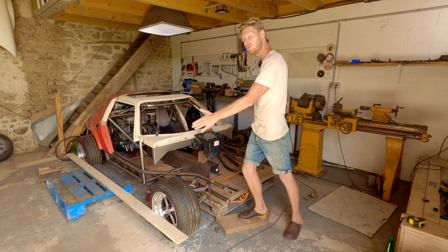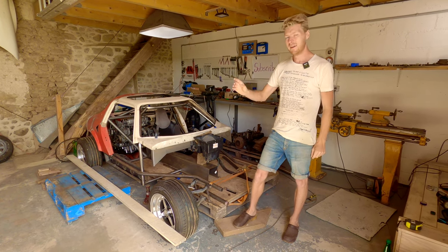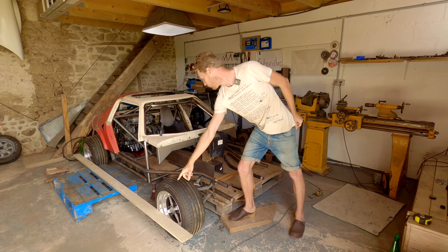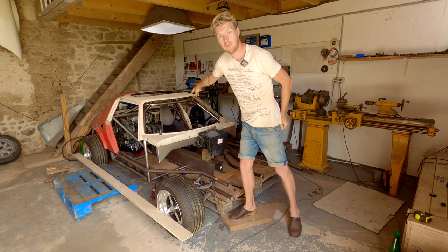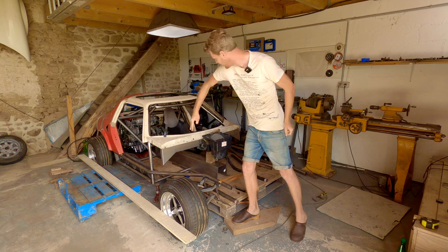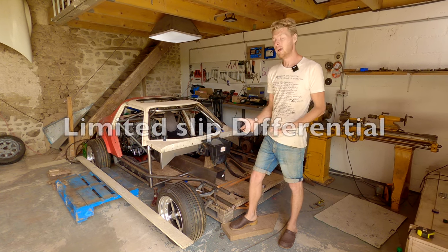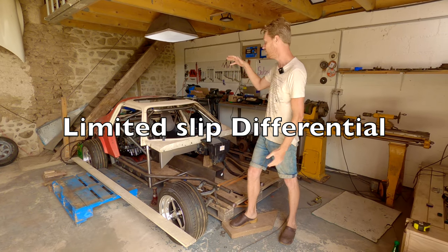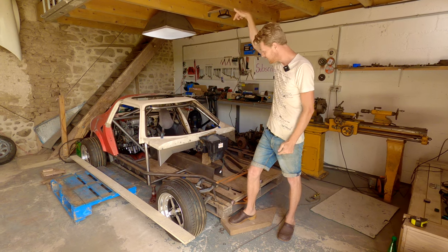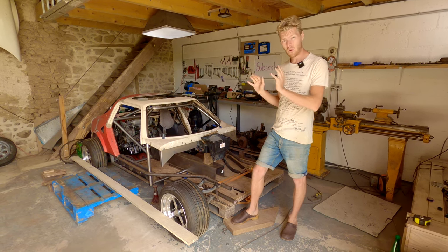Now, we've done everything we can to make sure this car handles as well as it possibly can and is as predictable as it possibly can. Even to the fact where, and this is super geeky, the pivot at the bottom of the suspension arm at the front runs all the way through to the pivot in line with the rear pivot on that corner and then to that wheel pivot. So this corner is perfectly in line with that corner, so that when this suspension compresses, it puts weight on that back tire because we don't have a differential. And we don't need a differential because we've got so much grip. We don't need a rear anti-roll bar because the front of this car will drive the rear, and this entire car will squat down vertically and give us a ton of mechanical grip. Under about 120 miles an hour, aero grip means nothing and it's all about mechanical grip.